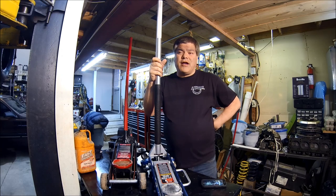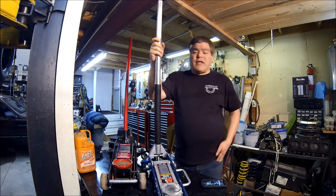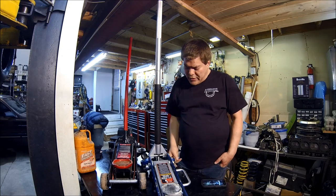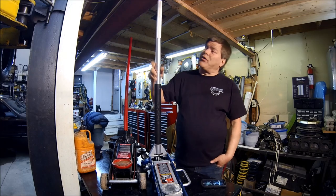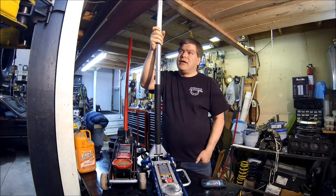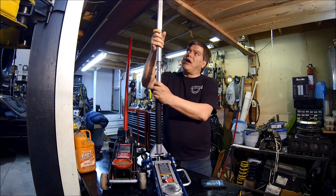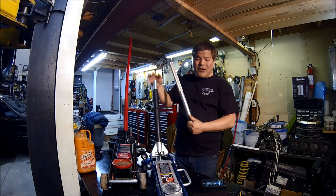In some cases, 10 inches is not enough because the spring sags and the suspension comes down, and your tire is still dragging. The other challenge we have is that in our pits, in the paddock area where the cars are parked when you're first setting up, a lot of the time it's gravel. So you've got challenges with your wheels and getting it mounted properly, and you're still trying to get the car up. And the second problem is the length of your arm. Often the paddock's very crowded, and as you let the swing come down, you're hitting the car next to you. So even though you've got a split in a lot of these where you can take the arm right off like this, the problem is that this is not enough stroke to get it up.